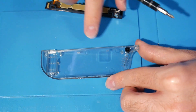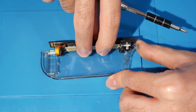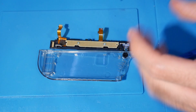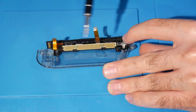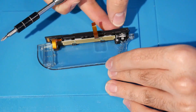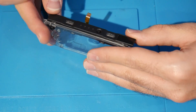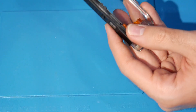Once that's all set up, take the two gold screws you removed and screw them back into the only two screw holes. Now take the bottom plastic piece, make sure the button is still there — you don't want to lose that — and put in the rail. Take the silver screw and pop it in place and screw it down. Once that's screwed in, that's about how your Joy-Con rail should look. It may look a little loose since it only has one screw right now, but that's okay.